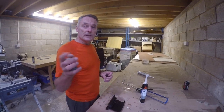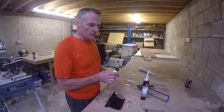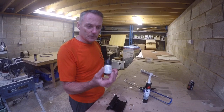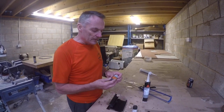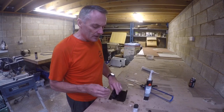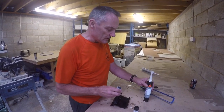Early on in the build when we fitted the bonded windows, it was suggested — or essential in fact — to prime the paintwork and prime the glass with glass primer. We just happened to have some left over, so I just feel that it would be good practice to prime the paintwork on the roof of the van and perhaps even smear a slight coating of it on the aluminium prior to putting down the Sikaflex.